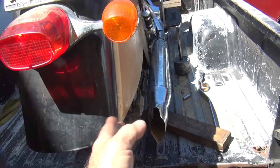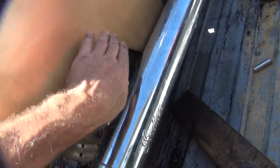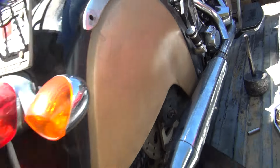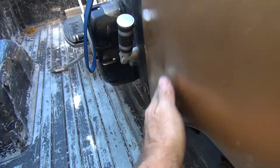About 1/8 inch clearance. If it wobbles around a little bit or shakes, it's going to probably hit the fender a little bit. So it appears that we're bending the fender right here. Yep, that's where it's buckling, right here. You know, it's mysteriously the same place it's bent on the other side over here if you look at it. Buckle. They match.